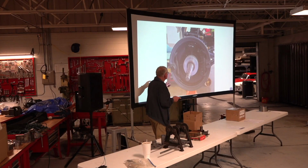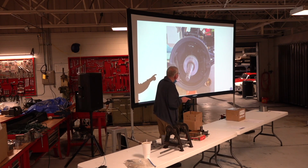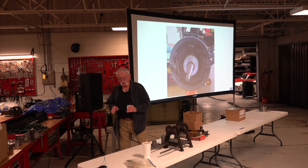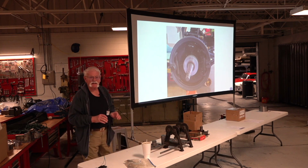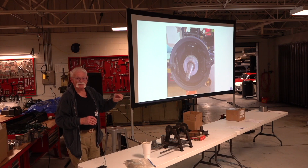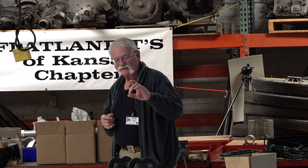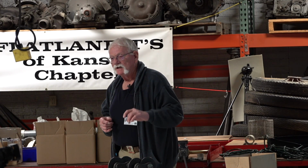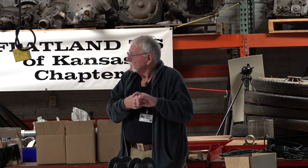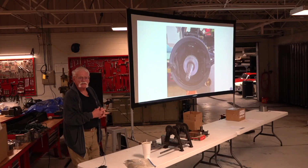about this is, if you've got an original rear end, and I put some together that I thought I had really nice bearings and really nice axles, nice bearings that were half inch diameter rollers, 0.500, and the sleeve in there was no wear, I'll tell you what, there was still a little bit of wear, because that axle will do this, and it'll knock that lip seal out of there right quick. But I don't use the felts anymore.